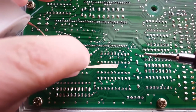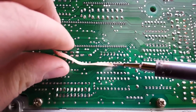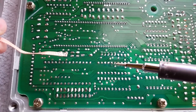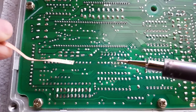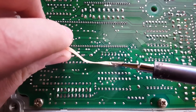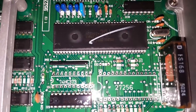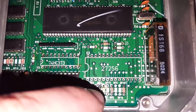We're going to desolder C51, C52, all the pins for the chip and the socket, the four pins for R54 and J1, RP18 and RP17, and the capacitor. Take your desoldering braid and set it down — I usually only do a few pins at a time. You can see it soaks the solder right up. Use this rather than the solder sucker if you can, because the solder sucker will sometimes pull the pads right off the board. If you're having trouble with the braid, try adding more solder to the joint first and then removing it. Keep going until all pads have no solder on them.